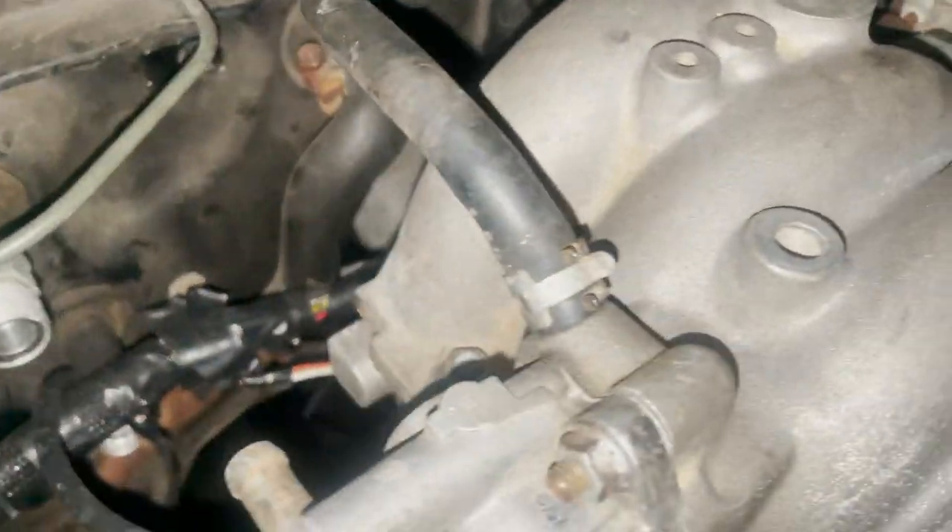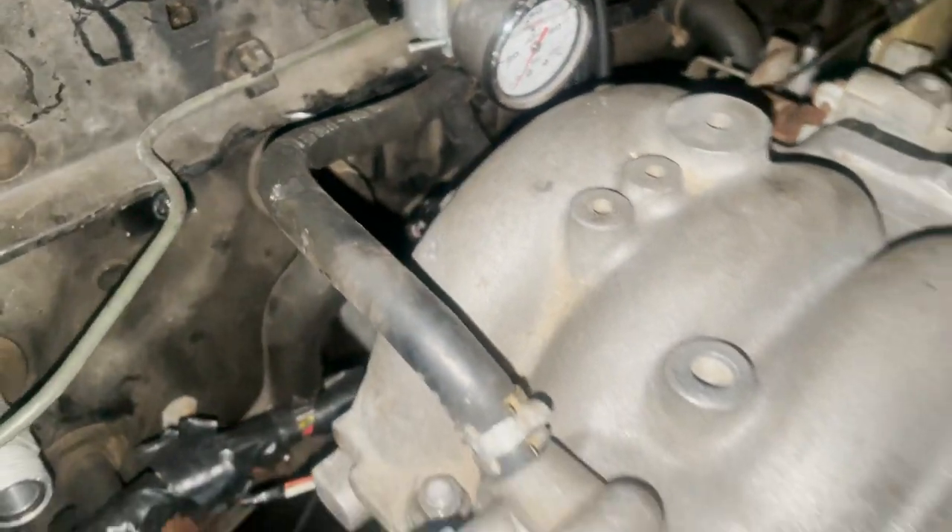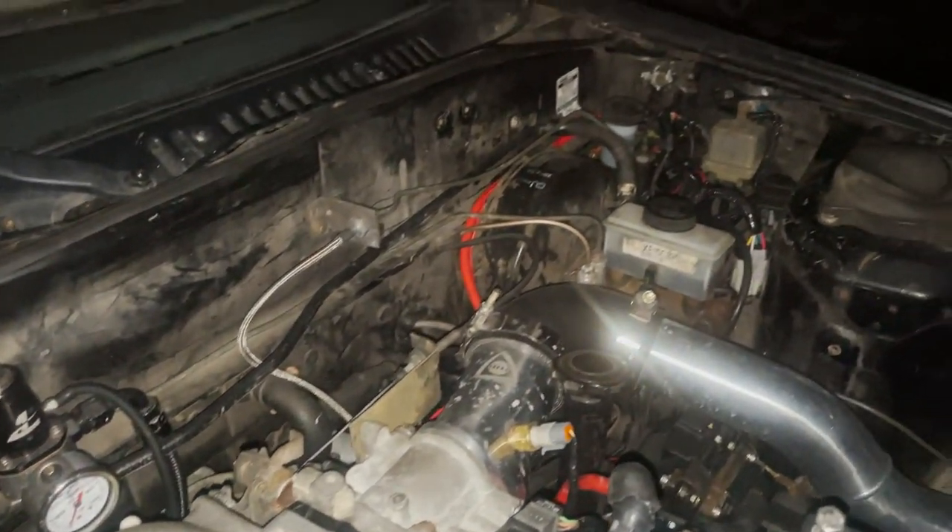I may have forgot a certain section — we all need brakes. You're going to have to figure out a brake booster solution. You can either get a Turbo 2 brake hard line, but that's annoying. What I did is I cut my brake line and used fuel hose from the auto parts store and connected it around — I'll insert a clip in the video. With Turbo 2 manifolds, the placement is obviously different, so that should clear up any confusion.